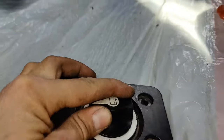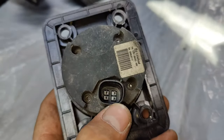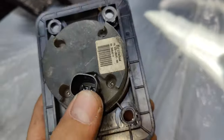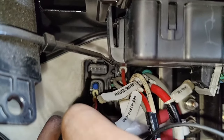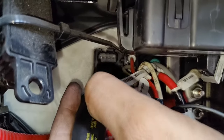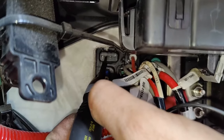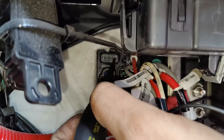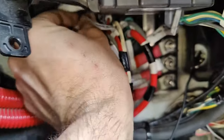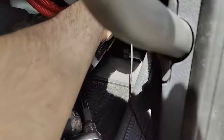When you're turning it on, it has four wires. On one of them, 12 volts is coming from the battery control module. There's a connector with four wires that goes to the auxiliary switch, and on the first one you have a plus — 12 volts. The others don't have voltage. I'm going to connect the connector back and show you where the auxiliary switch is receiving 12 volts.